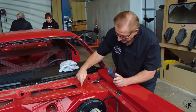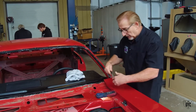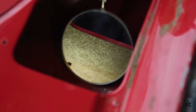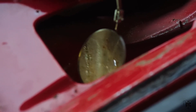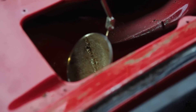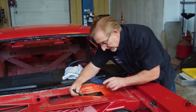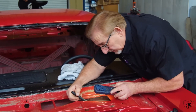I need to make sure there's no evidence anybody re-stamped the cowl, so I do that with a mirror. And that is beautiful — absolutely nobody has had that panel off. Now turning it sideways, I can actually see the welds — the backside of the welds — which is the kind of stuff you'd be looking for if you're trying to determine if a car has been fraudulated. Coming back over to this side of the cowl, you can see the seam sealer put on at the factory between the cowl and the upper cowl panel. It's still evident in there — that tells me nobody's changed the panel and nobody stamped the numbers. I can validate this as an original panel.